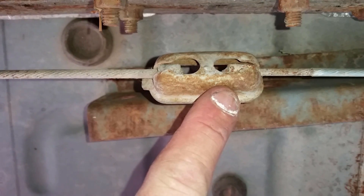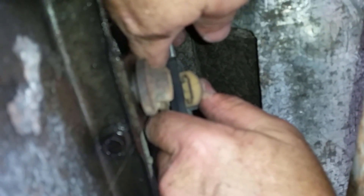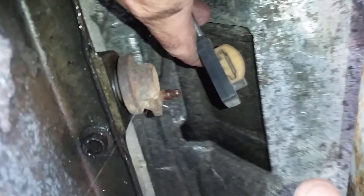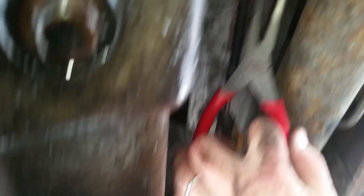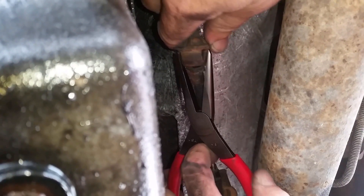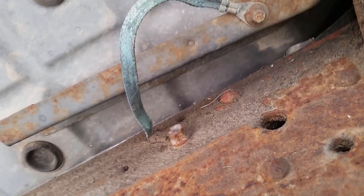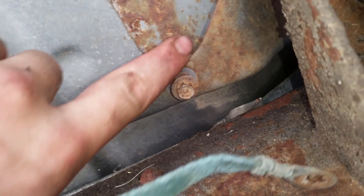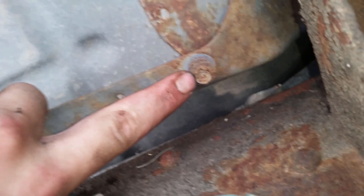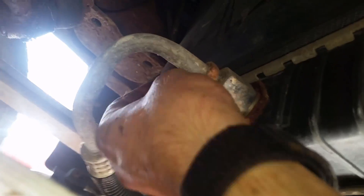Now we're going to want to remove the parking brake cable on the right side so we can fit it through the frame. Here is the transmission shifter — press in the little tab on top and pull it right out. Then take your pliers and pinch the little bracket right there and pull it through. Here we have a ground on the passenger side underneath the door — make sure you get all your little grounds like this so you don't leave them behind and get them stretched and broken. Go ahead and put your bolts back in when you're done so it'll be easier when you put stuff back together.